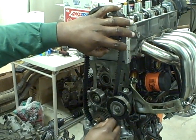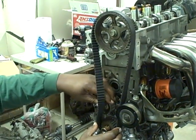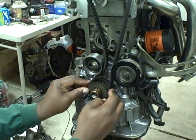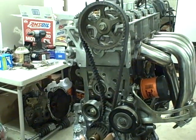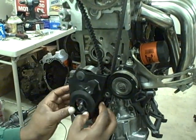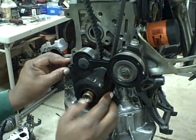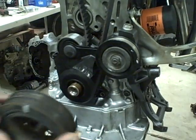So we just bring it down. You want to make sure it's good and tight so you don't miss any teeth. You want to get it around the tensioner like so. Once you do that, I usually double check it — I just put the cover on real quick lightly, line that up, put the cover on, and then put the harmonic balancer on again.